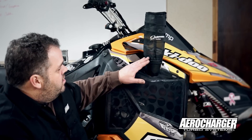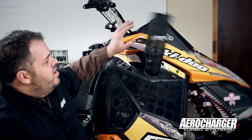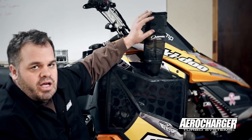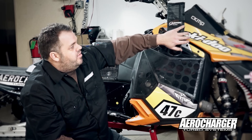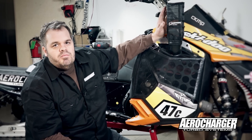The most important thing here is we've given the turbo options to pull from. We've designed our filter with a spring on the inside — a very open spring — so that when you're in the trees it can bounce around and not get ripped off the sled, and also the bouncing action will help clear it off. The filter itself is sized at five times the area that we need to feed the turbo, so we could have the whole front part iced over and still breathe from the back.